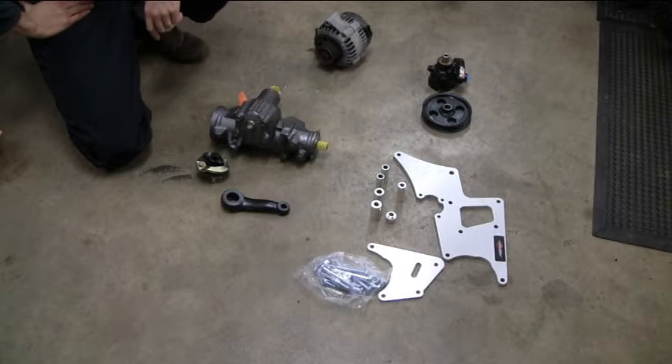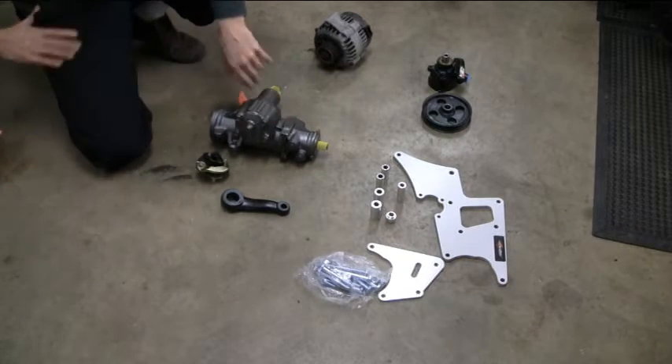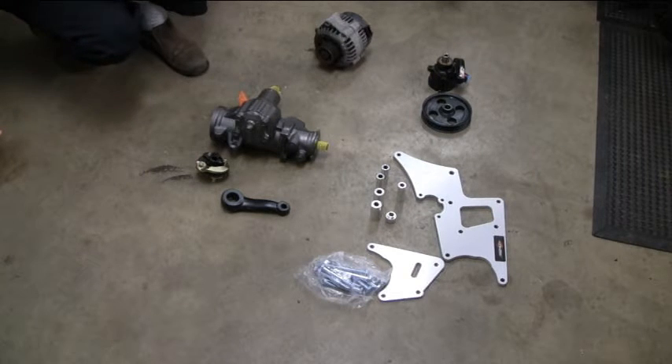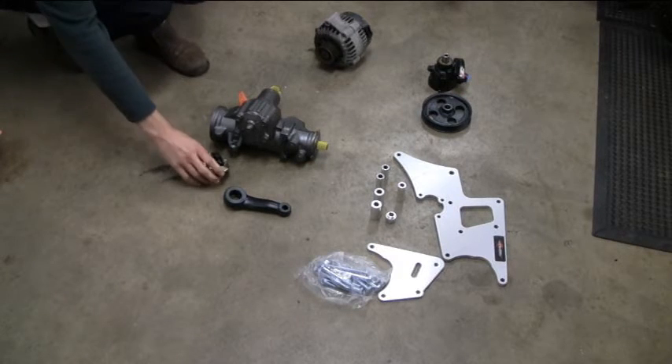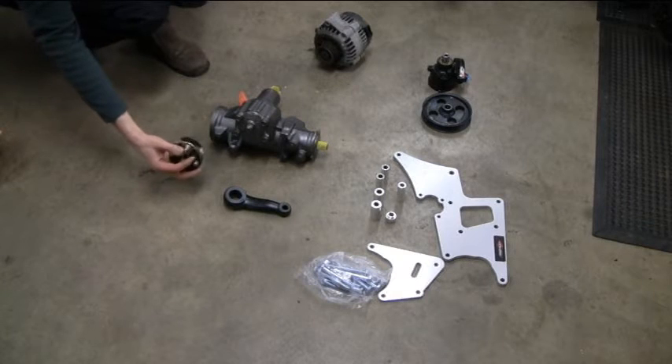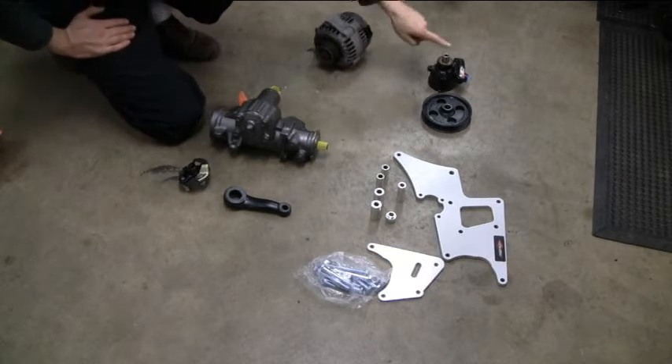This pile here is for the power steering conversion on the car. The car currently has a manual steering gear and I want to convert to power. The steering box I want to dry fit in here with the bracket, because it's a lot bigger than the manual box and there might be clearance problems. To do the conversion I had to get a new pitman arm off of a 1970 Chevelle, and a new rag joint which connects to the steering column. This box is actually for a 1997 Jeep Grand Cherokee — it's supposed to be a direct bolt-in, I believe it's a Saginaw 800 series box, with a quicker ratio and better feel at the wheel.